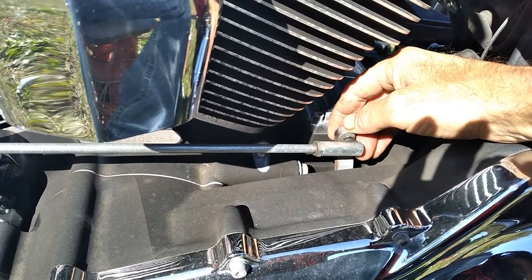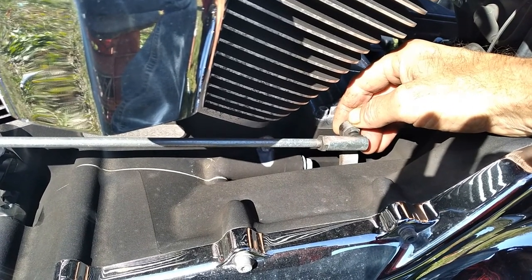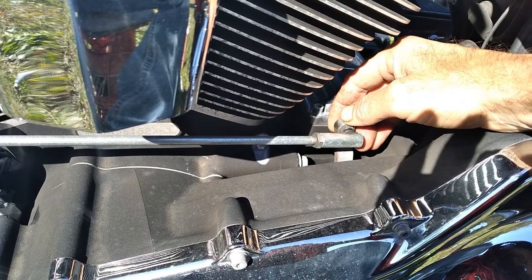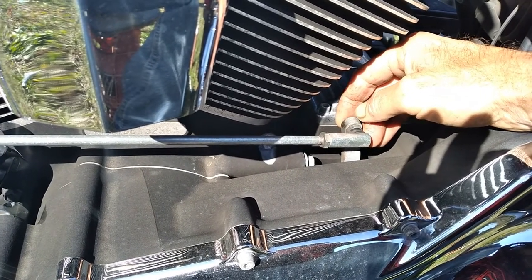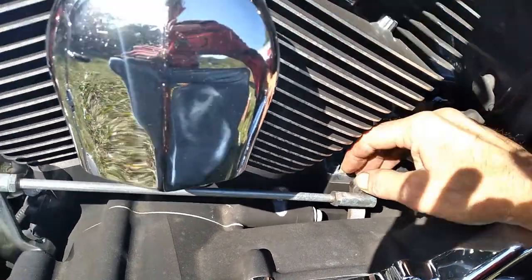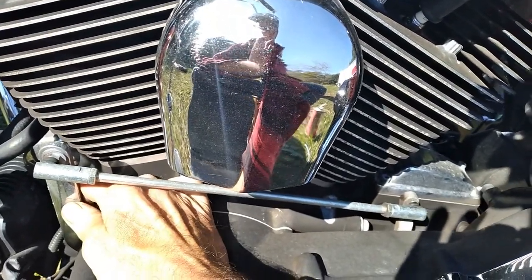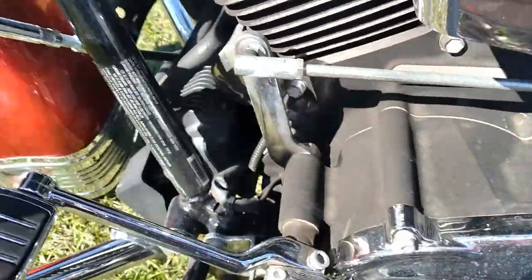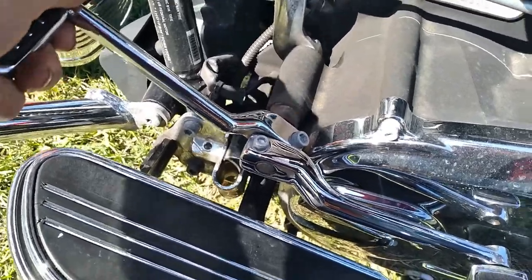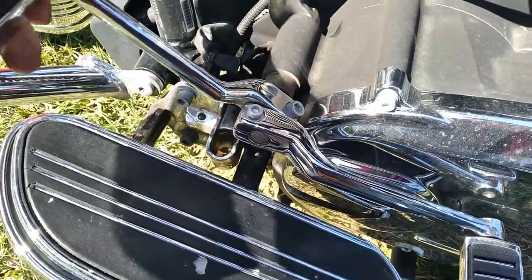If you get industrious and want to pull it out, if it's loose, take it out. Look at the bolt. If it's got a big stripe mark in the center of the bolt where it's been loose and riding back and forth on the shaft like that, you probably want to replace the bolt. Red Loctite on there. Same with the front here. You want to feel that one. If it's got any play in it, pull the bolt out and red Loctite it. This one here actually is pretty loose. I'm going to go ahead and pull that bolt out and red Loctite it.